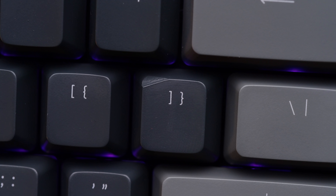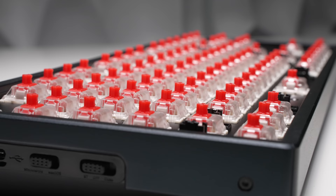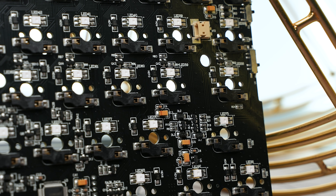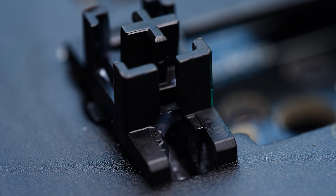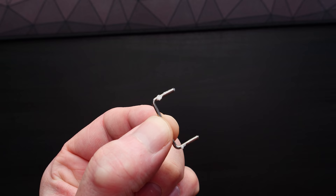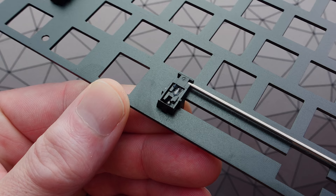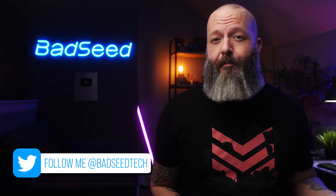Worth pointing out that my right bracket key came with the top corner sheared completely off, which was super weird. Underneath those caps, this board came with Gateron Reds, but the big highlight is that the board is hot-swap. These are north-facing for shine-through keycap fans, and they have 5-pin support, so no clipping your precious switches. PCB is black as well, which I really like. The stabilizers are plate-mounted, unfortunately — they appear to be a cherry clone. You can see they're lubed from the factory, but it's pretty inconsistent: there's a thin lube in the housing that's sparse, and then a dot of heavy grease on the wire. Being hot-swapped, these are easy to access and mod — at the bare minimum a good clip and a lube, which I did opt to do.